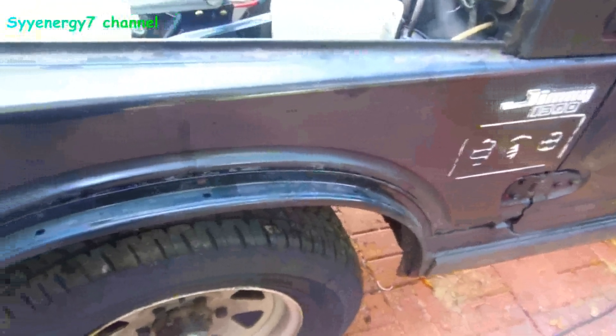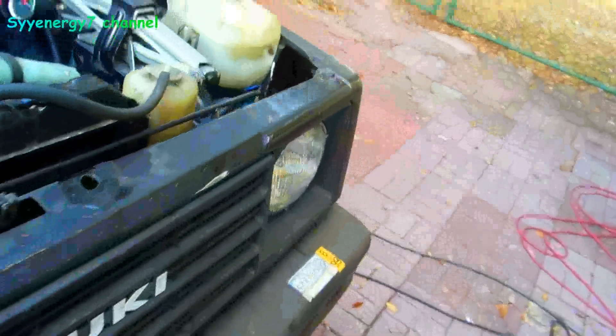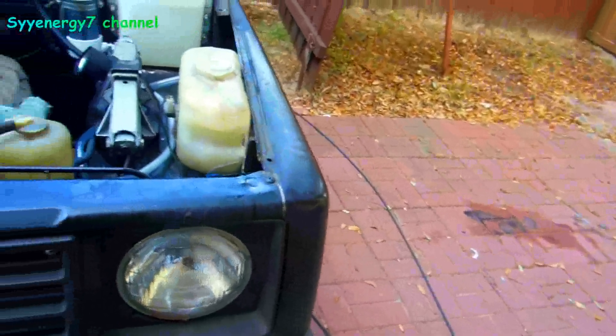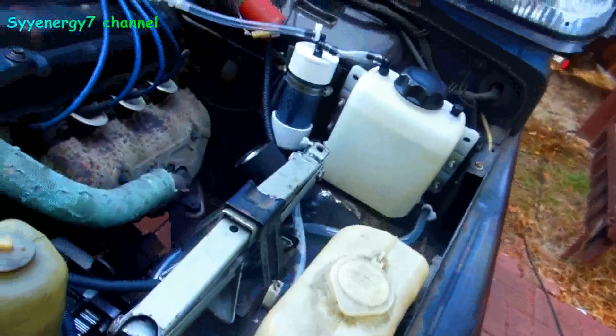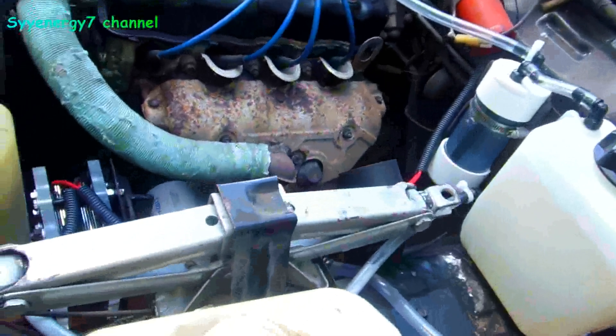The stock size tires on here are 195s. I don't know if it says so in the door. They are 195s, not 215s. I put it on a tire calculator — 195s versus 215s actually makes almost three miles an hour difference, two and three-quarter miles an hour different at 60 miles an hour. So I definitely got 30 MPG, no matter how you put it. I never did that before.